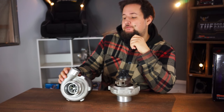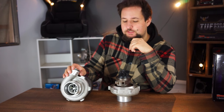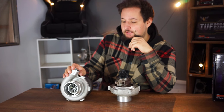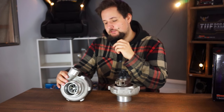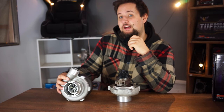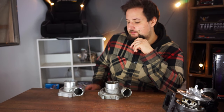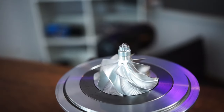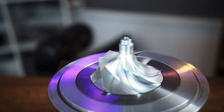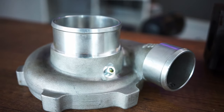For this example I have two different turbochargers here, which are two GT28 units, and they are somewhat different. I'm going to show you now what the difference is, because that is quite relevant for how to make your turbo louder. This difference is in the compressor housing, because that unit right here — which is a Pulsar GTX 2860R — has a provision for the turbo speed sensor.